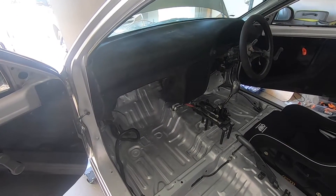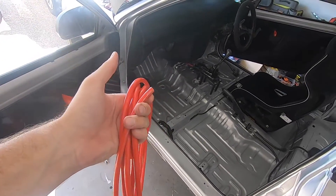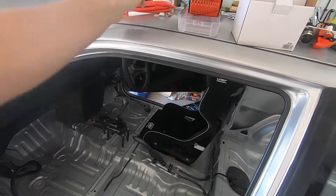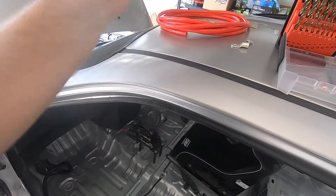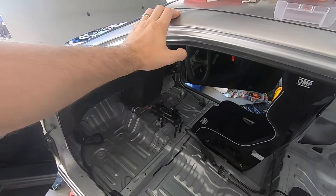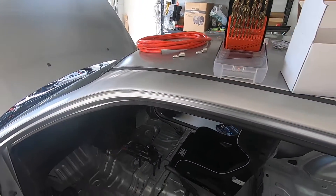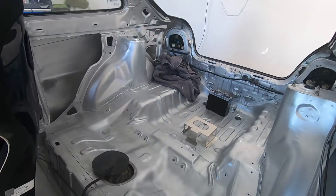I'm going to start getting this cable out. I went to JayCar and got a new four-gauge cable — same as what was in the car — some lugs, and I also have from when I was building my cart trailer a heavy-duty crimp tool which I can use to crimp these together. First things first I'm going to unwind this, crimp that on, and we'll start running some cable to get it mounted towards the back. We'll also have to drill holes for the bracket down there to slip the battery in.